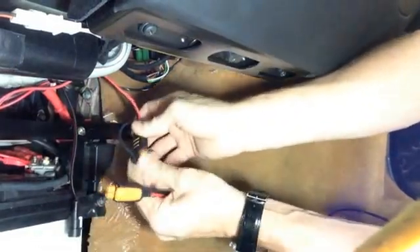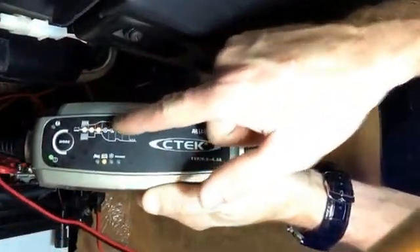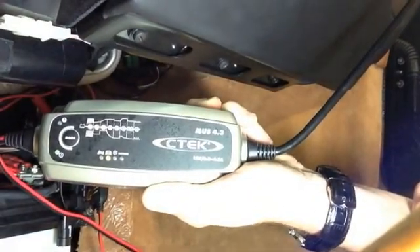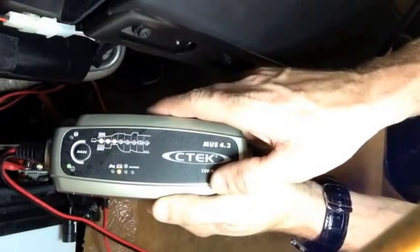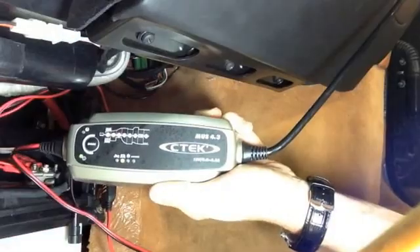Here's the CTEK, and we're going to take this — it's a zero insertion force connector — plug it into the right plug, plug it in like that. The CTEK charger is going to go into its various phases. Since this battery's already charged, it'll probably go into stage four in just a second. Eventually when you get back to your car there will be a nice green light on it saying it's fully charged. Alright, that's it.